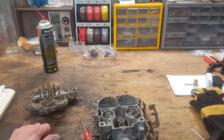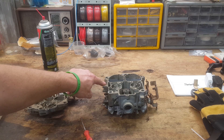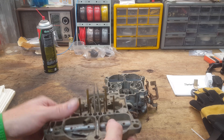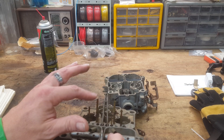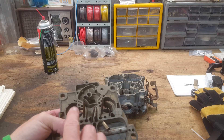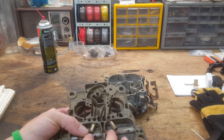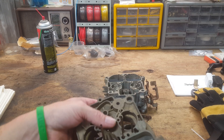When the back throttle blades open, airflow through it pulls the air doors open. You have to have a fuel pathway. There are tubes in here — you have six tubes on this high-performance version, some may only have four. Generally you have two tubes for primary pullover enrichment, two for secondary pullover enrichment, and two tubes that are your fuel supply for the secondary side — those are the secondary discharge ports.